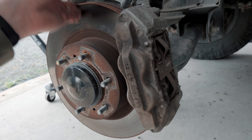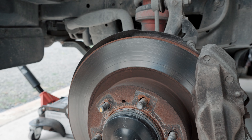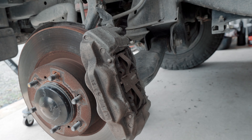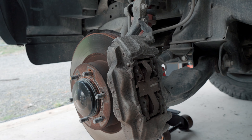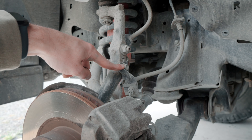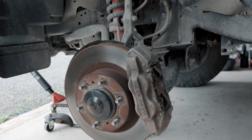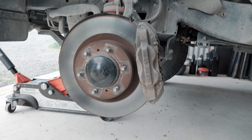Here we have the factory rotor with 30,000 to 32,000 Ks on it — it's looking okay. I do use this car, it goes off-road and on the beach, so it's looking pretty good. It'll be interesting to see how much meat is left on the factory brake pads. We're going to take the brake pads out and then undo this bolt up here to get the brake hoses loose, undo the big bolts holding it in, and basically everything pops off. We should just put the new ones on, new pads in, and we're done, hopefully. Let's start with this front wheel.